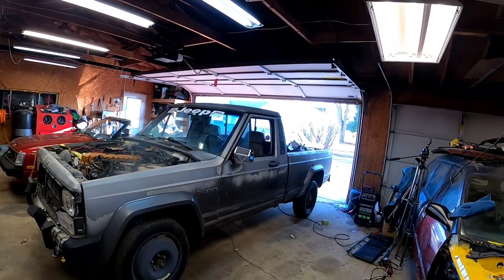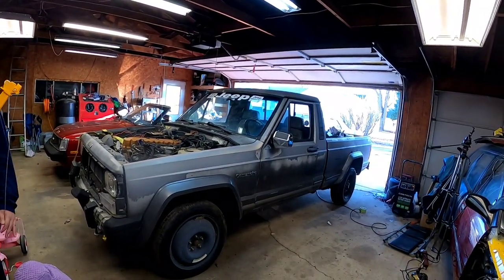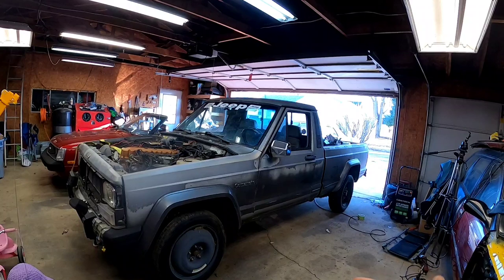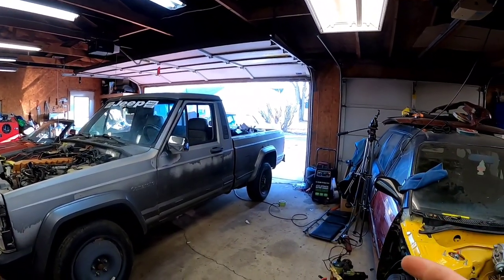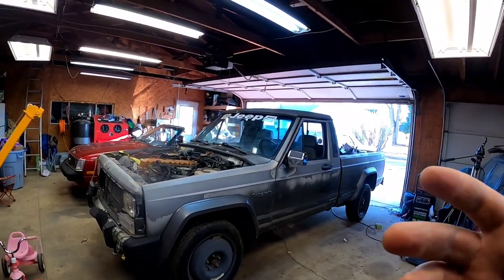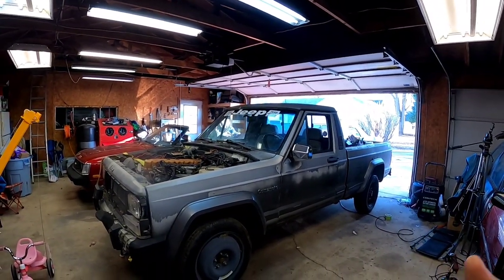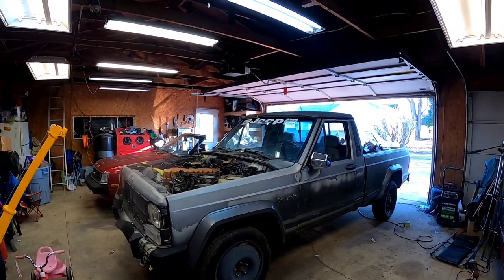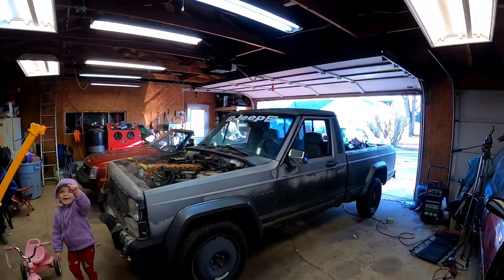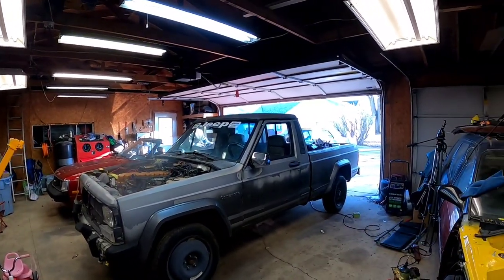So at this point, it is either A, the grounds, which are notoriously bad on these things and very underwhelming, are still bad and that's not letting it start, or the new ECM and the old ECM are both bad, which is very frustrating for him. As me and him were talking about it, they didn't pull the engine out and rebuild it because it wasn't running. It was actually running very well, but it smoked a little bit, if I remember correctly what he said. So they were pulling it apart, rebuilding it. They put a '95 head and stuff on it because that ups the power a little bit. That was kind of what they were going after. They weren't trying to make a real big hot rod out of it, but they were trying to give it a little bit more pep.